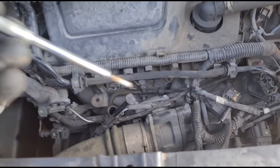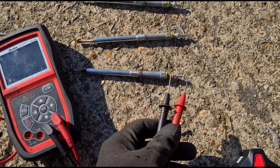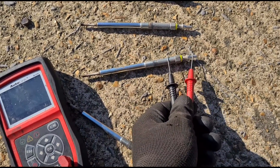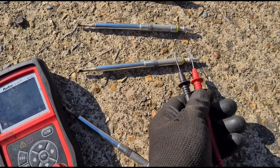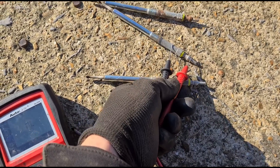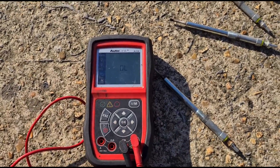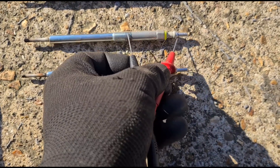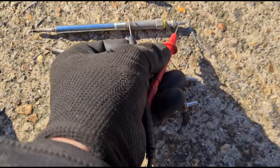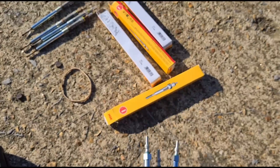While that's holding pressure, I'm removing the glow plugs — we're going to get all four of these out. We've got the four glow plugs out, in the order they came out. Number one has no resistance, number two is getting something, and number four is dead. You can see number four and number one are faulty, so we're just going to replace all four of them.